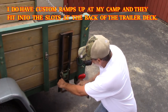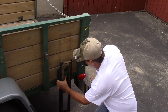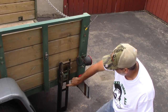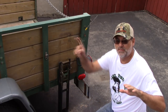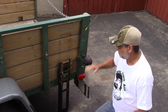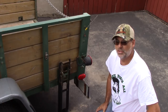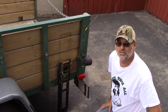These are just made up myself out of angle iron. You turn it upside down and you put that through, put your pins in — top one and bottom one — and now you can lower the jack on the front and bring it down so it's level on the ground, or if you have to put a board underneath there. When you're going up on your ramp, you're not pushing down on the back of your trailer and wrecking your ball connection up at the top. I think this is a good modification to do, and this was just made out of angle iron and it's served me well.